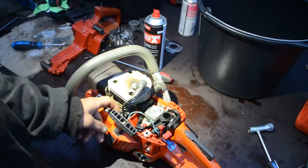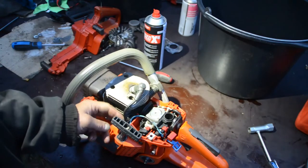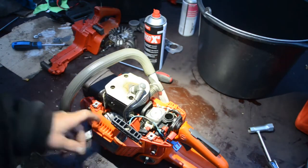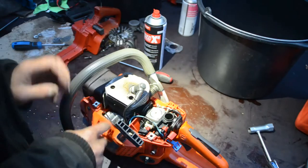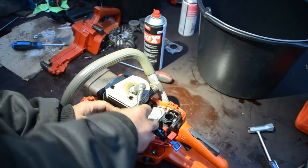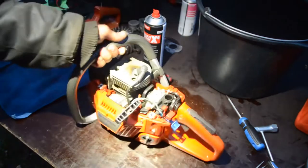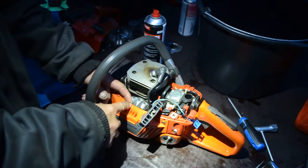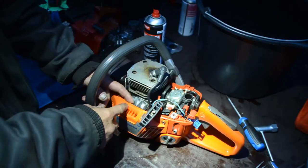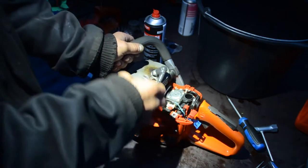Aha, this wire is compromised. It could touch the flywheel, and that we don't like. So it's too short, actually. So now it's squeezed behind the dust cover and actually the starter cover, so the wire will not just jump out and onto the flywheel.